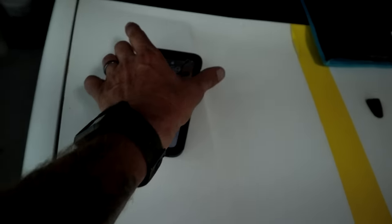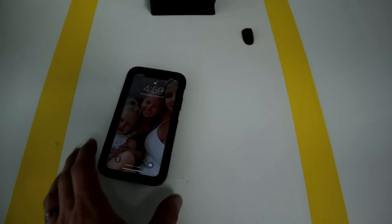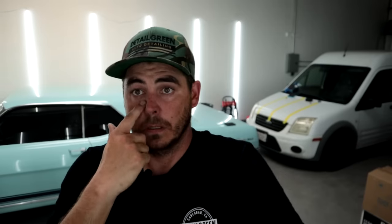The clay mitt — much better than the clay block, but there's still quite a lot of contamination in here. Slickness is better, definitely less contamination, but still not great. The last one, the clay pad, did a pretty good job. The only things I missed were right in the corner and a little bit right there — similar to the traditional clay side. It slips right off.